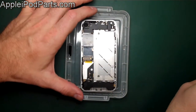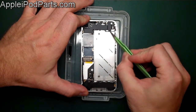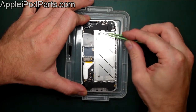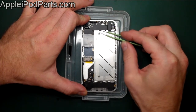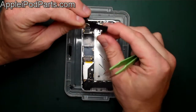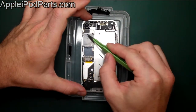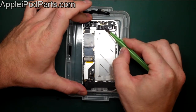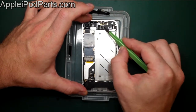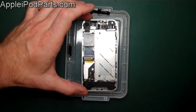The bracket has a couple of little hooks that hook into the bracketry on the mainframe. Use little tweezers, come down on the hook, pull it down and up, and it just comes off nicely. There's your little black Wi-Fi bracket with its little clips and contacts. That exposes all the connectors for the screen, the headphone jack, the camera cable, and the buttons cable.